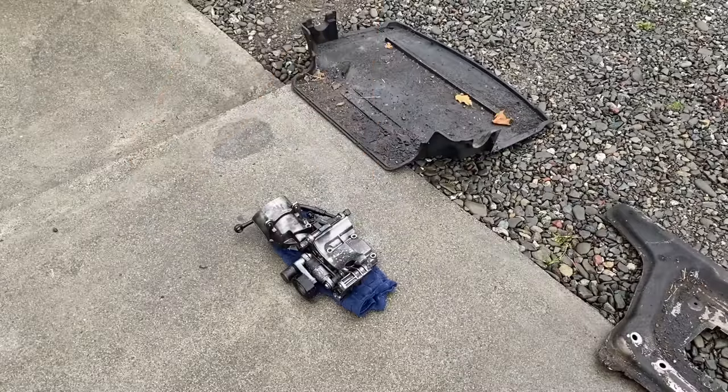We'll do like 18 PSI, put it right on 17, and let that chill while we finish up the rest. We need to get some oil back in it, so we're using this O'Reilly Full Synthetic Euro 5W-40. This stuff was cheap, but more importantly it meets the BMW Long Life 01 Synthetic Standard, so we're just going to use this. It's cool to see that O'Reilly's oil is made in the U.S. This thing's going to take 7 quarts — we'll throw this full 5-quart jug in there, then just need another 2 quarts out of a second one — 7 quarts total.